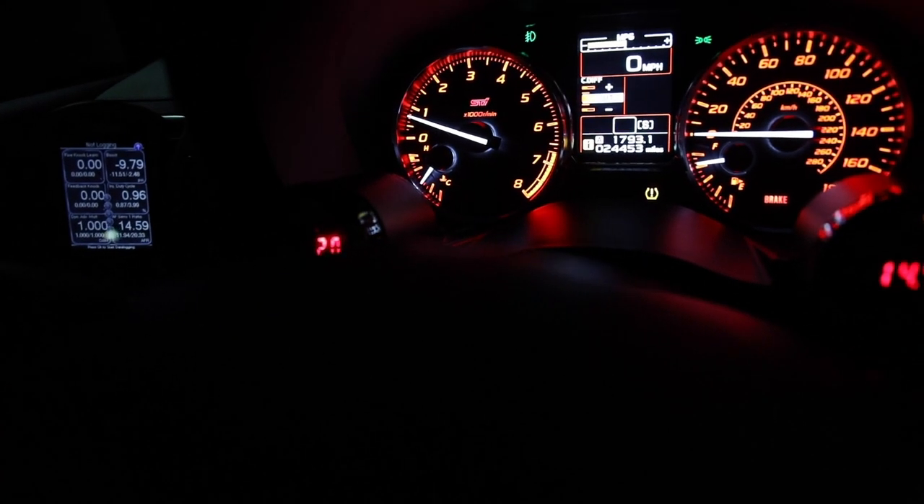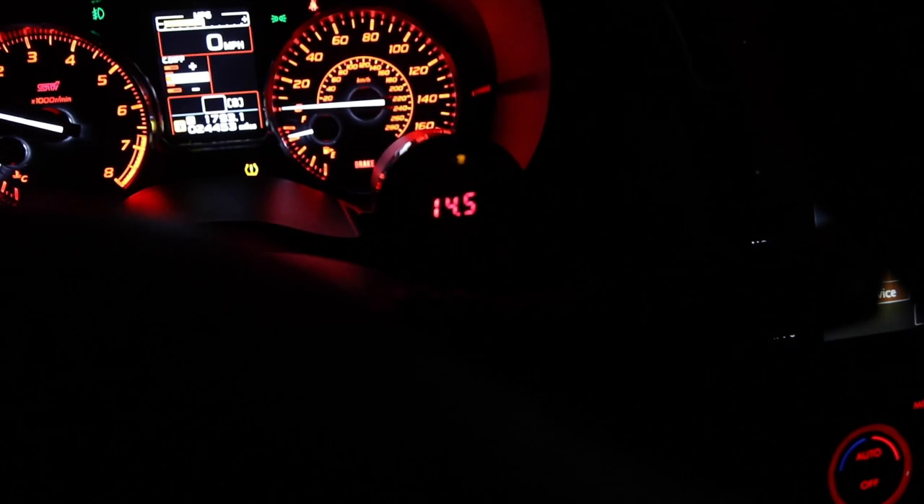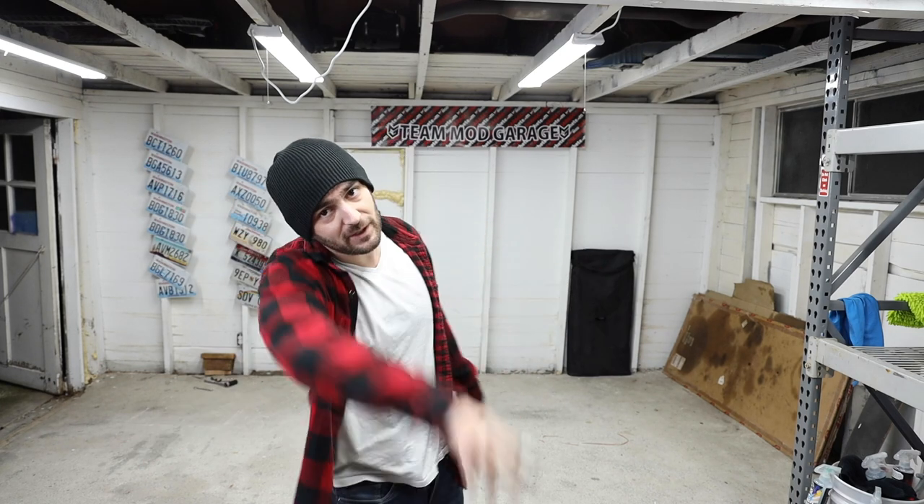Now that the car is warmed up a bit, you can see oil pressure dropping — that's normal. Warm oil pressure should be around 30 PSI, and as you see when I rev it the oil pressure matches. Everything looks good. I love the little spot for it down here — it fits nicely with the airlift gauge and the STI logo, and goes great with the air-fuel ratio and boost gauge. There you have it guys — oil pressure gauge, it works. It only took two videos to make it work because I forgot to order one of the parts. Learn from my mistakes.